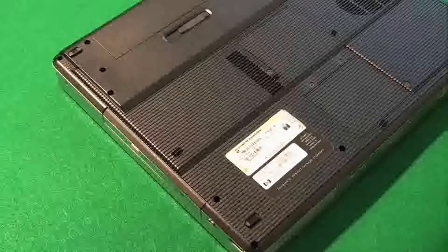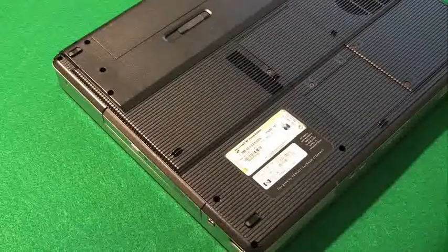Now let's go over how you remove a drive from a laptop. It's really easy — CD and DVD drives are one of the easier things to work on in a laptop. You're usually going to see an icon on the underside of the computer with a little disc-type picture on it, like you see here. Next to that picture is usually a screw or a hole for a screw, and CD/DVD drives for the most part usually come out with that one screw.